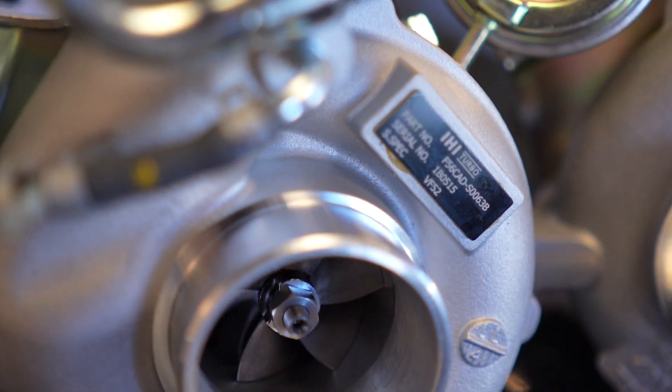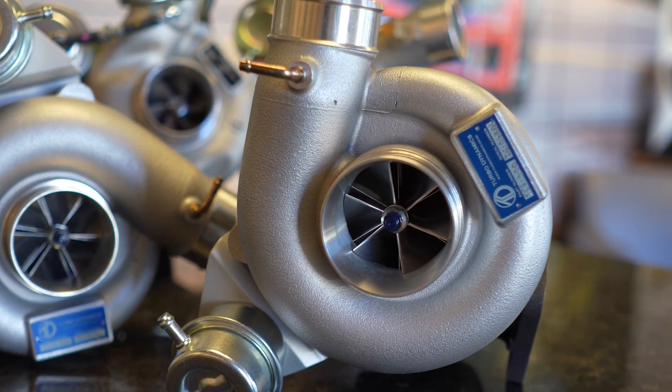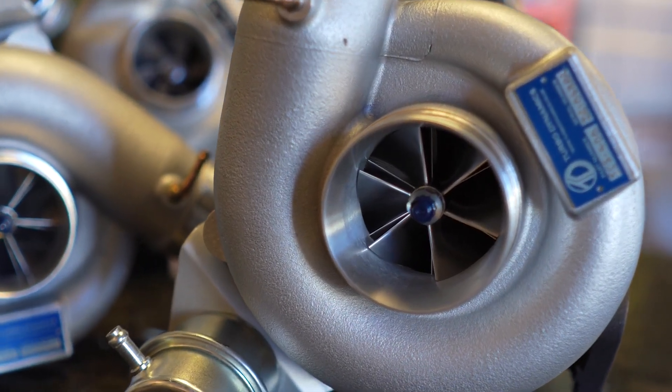When you come to air and fuel, you can't forget the turbocharger. The turbocharger is taking the air after the mass airflow sensor has already taken its reading and compressing it — packing it together, making it more dense — so that you can get more air into the cylinder to make more power, which also requires more fuel. But different turbos compress that air in a different way with a different efficiency. That's why changing the turbo can also require a change in calibration, because the car needs to know how that turbo is going to compress that air to make that intake charge.